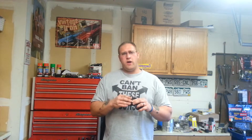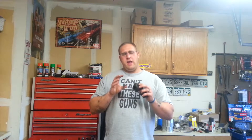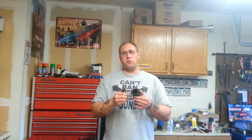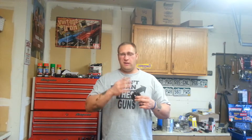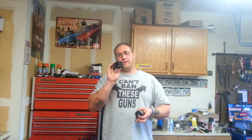These are also highly affected by grease and oil — they can swell and they don't work very well. Inside your suspension, these deflect very, very easily. I can grab this and squeeze it just between my fingers and feel it compress. Now that may not seem like a big deal, but if you combine all the rubber bushings in your suspension, all the little bit of flex they have at each moment, that adds up and can dynamically change your alignment settings while you're driving. It effectively takes away how your suspension is supposed to work — so this is not very good.